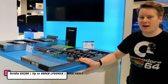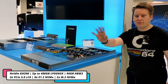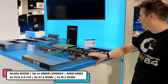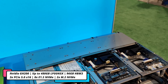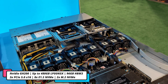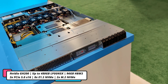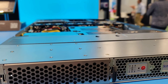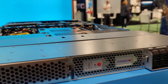The H100 supports 96 gigabytes of HBM3 and 144 gigabytes coming soon, plus lots of integrated LPDDR5 with that connectivity link. There are three PCIe 5x16 slots for additional connectivity. They're advertising Bluefield 3 and ConnectX 7, so we're going for a full NVIDIA solution here, and then a couple of M.2 drives.